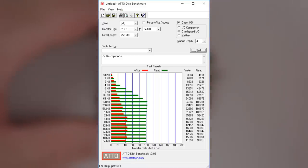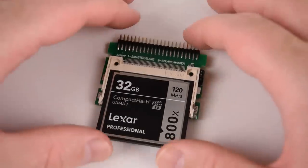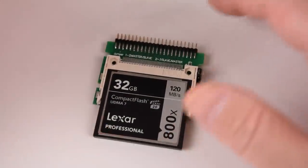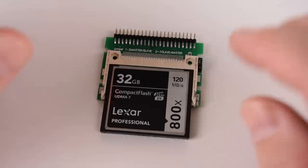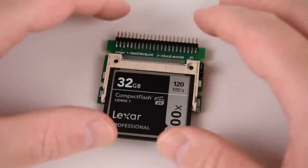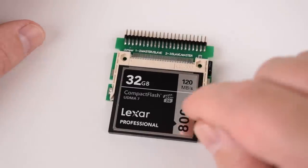It maxes out the IDE interface but an SSD is stronger with smaller files. The highlight of using flash or any storage without a platter and read-write head is the access time — don't get too carried away with transfer rate, because an old machine can't process that much data anyway. Having near-zero access time is actually what gives you the speed. My recommendation is to use compact flash mostly for DOS and maybe Windows 98 — I wouldn't necessarily recommend it for Windows XP.